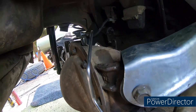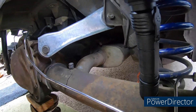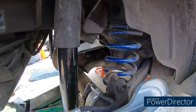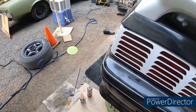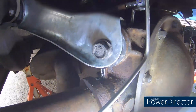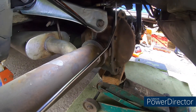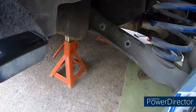Got this side in and it's coming together - I just love shiny stuff on this, everything else is so dirty. Got it in. Gonna have to jack up the differential to simulate ride height and then do the final torque. Just showing you we got both of those bad boys in there, got the new bushings inside the differential housing as well. Reattached the brake lines - they took a beating but still aren't leaking. Now we'll move on to tackling these lowers.